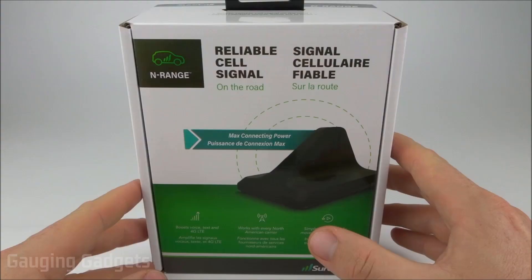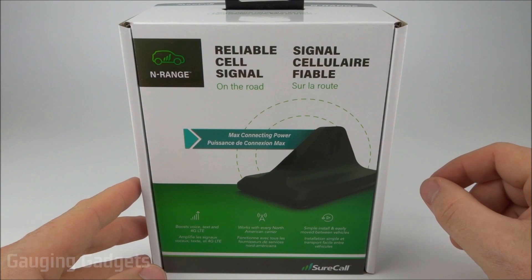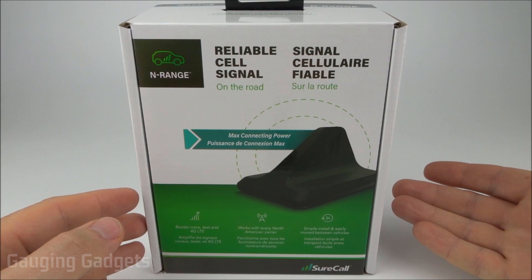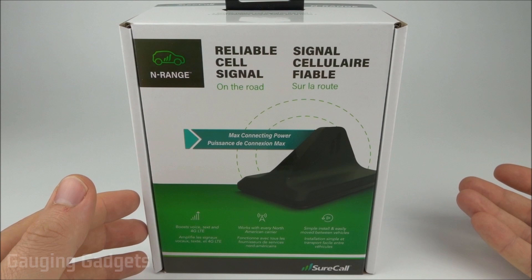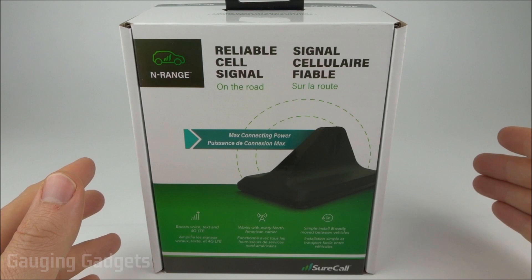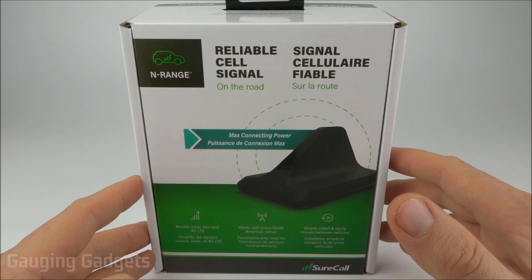Those were four tests across Verizon, AT&T, T-Mobile, and Ting. Research shows that every 3 dBm increase is actually a doubling of signal strength, so even a 6 dBm improvement with Ting, T-Mobile, and AT&T was more than doubling the signal. Most importantly, with T-Mobile I was able to place calls in dead spots in my local area where I previously could not — a very successful real-world test.